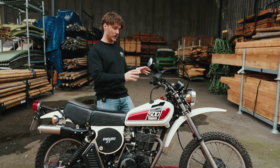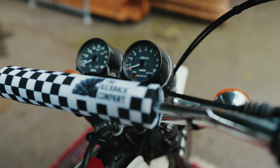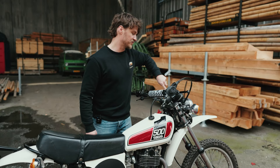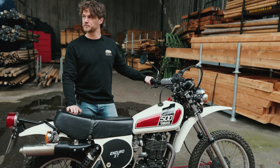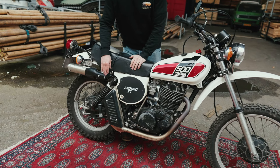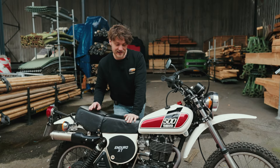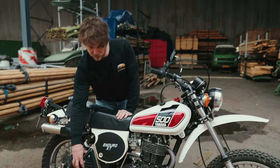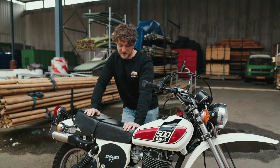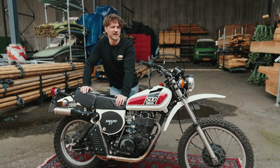The first of those hard-to-find parts is the cockpit. It's difficult to find one with the day counter still on it, or without the colors on the frame being faded by the sun. The exhaust is also very difficult to find — this one is from the '76, but the original '77-plus exhaust with the flamebox is hard to find in original, non-rotten condition. The flamebox often came off or was removed to make more noise. There are some companies making these mufflers new, but it's an expensive repair.